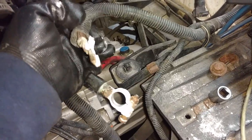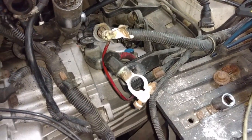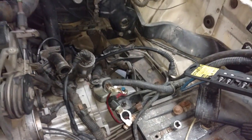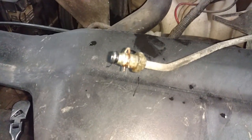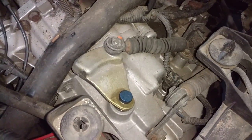So let me go ahead and unplug that end of the wire and pull this whole airbox and slave cylinder hose out of here. I got the master and slave cylinder hose out in the assembly. I got the clip on there. Replace that clip on there so I don't lose it. Now I'm going to set it aside. I'm going to go put the vehicle in neutral.